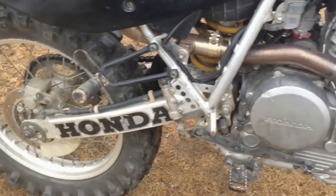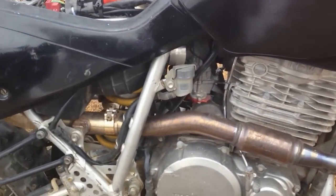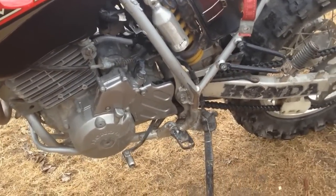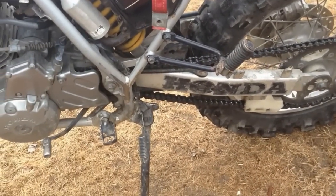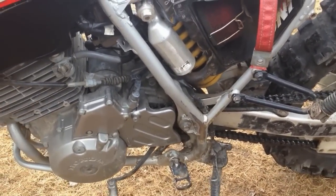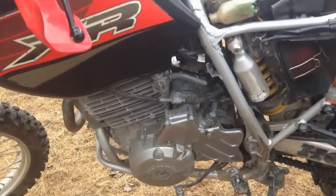My next major mod, and you can't see this mod, it's in here, right inside there. I've got the 5th gear mod and the 2nd gear mod, which are the next best mods on this bike, I believe. It allows me to run a really large back sprocket and a small front sprocket combination. I've got a 14/49 on it right now, and it's wicked from 1st, 2nd, 3rd, and 4th. But the 5th gear is more like an overdrive gear.